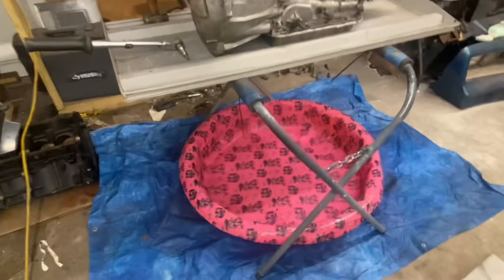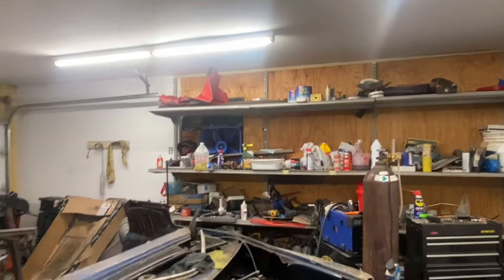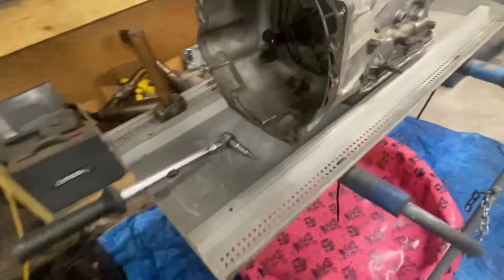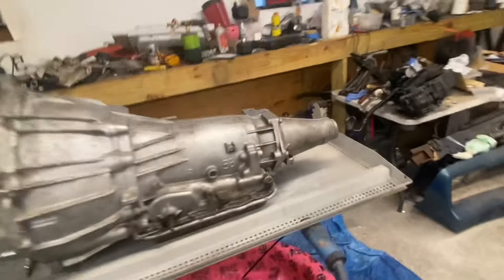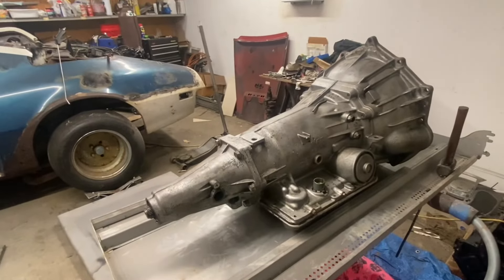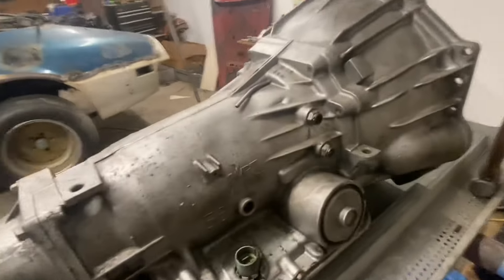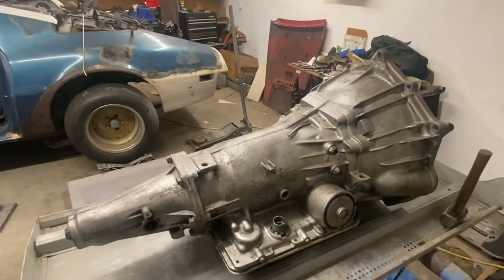I had already pre-drained it. You see this stand I got set up — it's actually a shelf that came off one of those shelving units. I made me a little table, it fits up in there perfect. Trapped the fluid, got a kiddy pool on the ground. This is my first time ever working on a 4L60E. I don't think this one had gone into third or fourth — fourth wasn't going in. When I pulled it out, one of the lines wasn't all the way in there, so that gave me some hope that it might be all right. Y'all tune in — Mr. Random, let's get it.